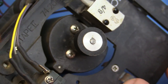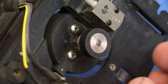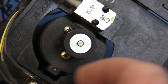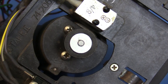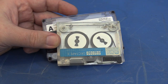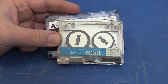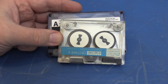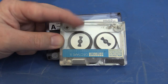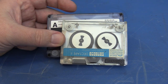That was a fairly easy fix. So if I find any good TU-58 cartridges in my collection and image them, I can at least repair these drives for use in machines like my VAX-11/730. Even if you have good drive bands available for repairing TU-58 cartridges, those bands are really difficult to install. I have a couple dozen cartridges I want to image, and I'm wondering whether it might be better to transplant their media into a different mechanism that dispenses with the drive band entirely.